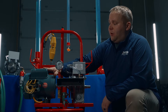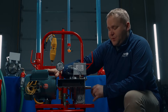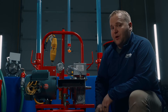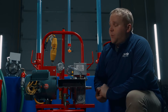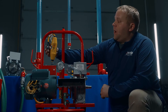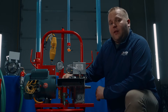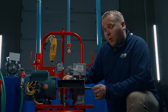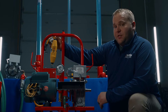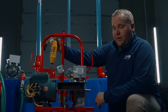When I'm running the vacuum, the motor, I'm using about 7 amps. When the motor is running and I'm discharging, I'm using about 13. So pay attention to where you're plugging it in and what else could be running on that circuit. Are you plugging directly from the 20-foot cord we provide into the wall? If you use an extension cord, is that cord the same thickness or thicker than this 12-gauge? If you're using too thin of a cord, that could be an issue.